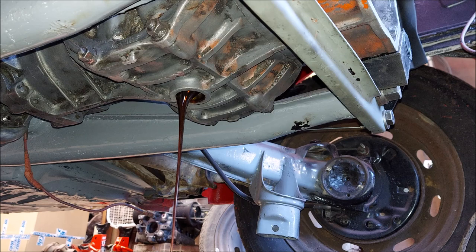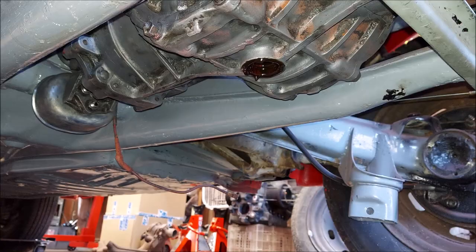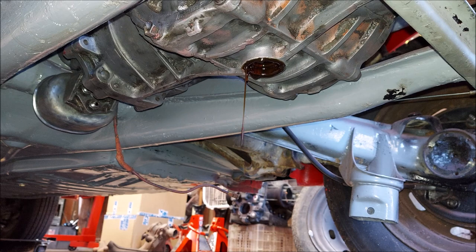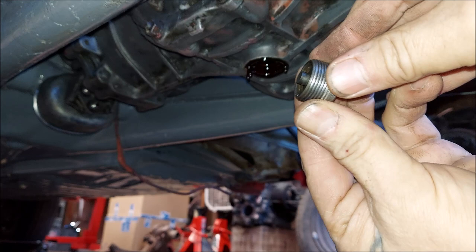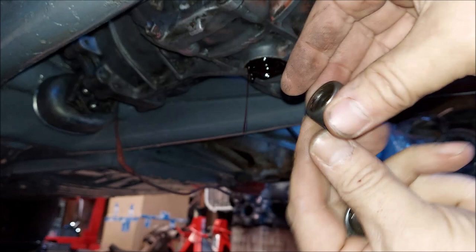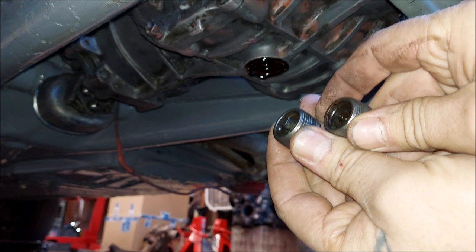The fluid actually doesn't look that bad coming out of this, so we're going to refill it with fresh fluid and it should be done in a minute. I'll speed up the film while it's dripping so you don't have to watch, but you can at least see what it looks like when it's done. Make sure when you put it back on, your drain plug is the one with the magnet in it — see the little magnet end there. The plug for the side doesn't have one because all the contaminants go to the bottom and collect on the magnet. A lot of people don't pay attention to this and it's very important.